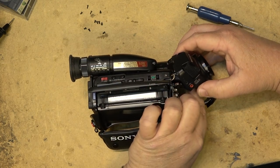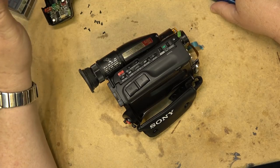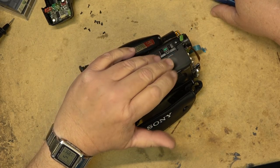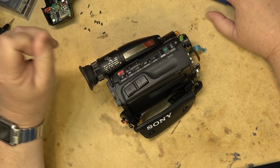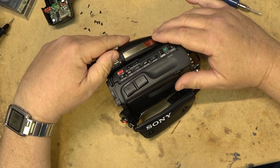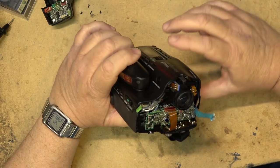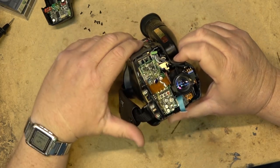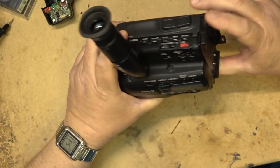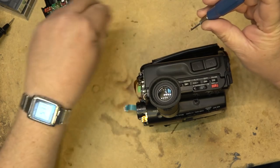I did some test recordings earlier at 100 megabits in 4K mode, recorded for about 15 minutes - about four gigs worth - and it didn't shut down. On the SanDisk card I could only go to 60 megabits; both my AX53 and AX33 would say 'this memory card does not support' at 100 megabits because it was only a UHS-1. This new one is a UHS-3 ultra high speed card, so I think that will eliminate the shutdown problem - I've had more issues with SanDisk cards than anybody else.